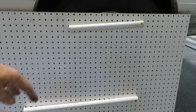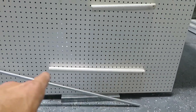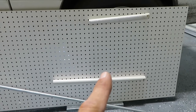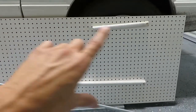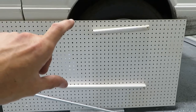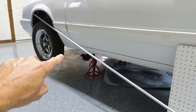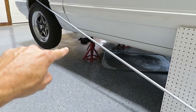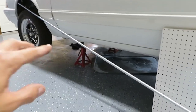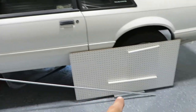At stock ride height — and this is just an illustration, not exact angles — the lower control arm is more level and the upper control arm is pointing down just a touch. If you draw an imaginary line through these, the lines are going to go way out and meet somewhere out front. That meeting point is going to be below your anti-squat line. This is just a representation — it does not mean this is exactly where the anti-squat line is on this car.